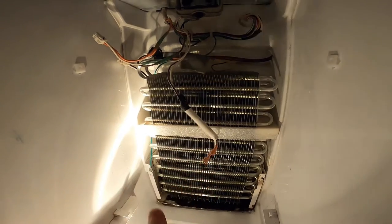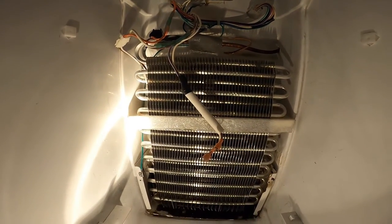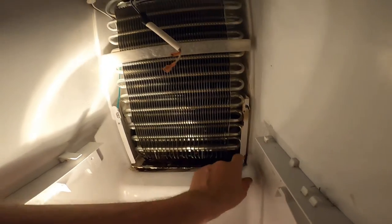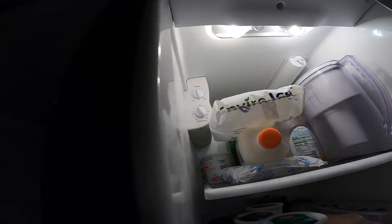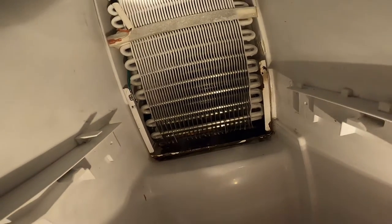I'll plug this in, zip-tie everything up, and I'll see if this thing works. We'll go ahead and put it in defrost mode and see if this bugger works. So I just turned it on — wait for the stuff to get frosty a little bit, then I'll hit the defrost mode and see if this element down here gets hot. So I let it cool down, I just put it in defrost mode — and you can see that smoke in there! That thing is working. It's just a thermostat. I did the cold to off, cold to off, cold to off three times within six seconds, and we have steam. I just touched it and burned my finger — it's hot. It's working! And it's fixed.